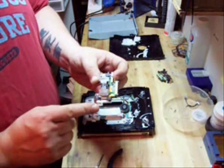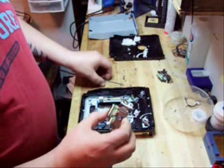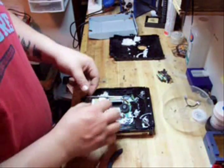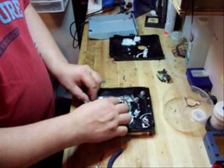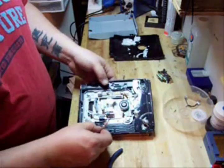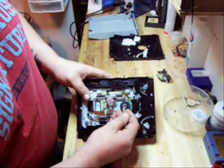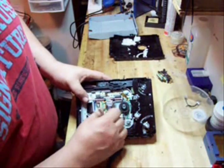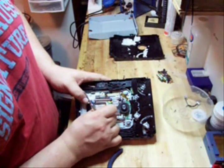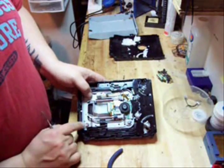Now we have our laser with the white clip and the spring clip put back on it. We're going to install the new laser. Take the rod and put the rod back in, get the laser back in like so. Push down on the front of the rod so it goes under the spring clip here — you want the rod to go under that spring clip. Then push your laser all the way forward; see how it turns the worm gear and actually cocks the back of the rod out. Slide the rod down in like so.